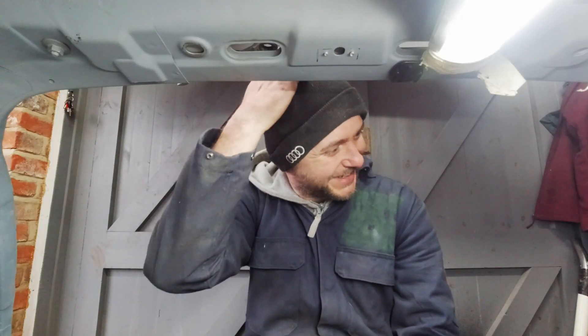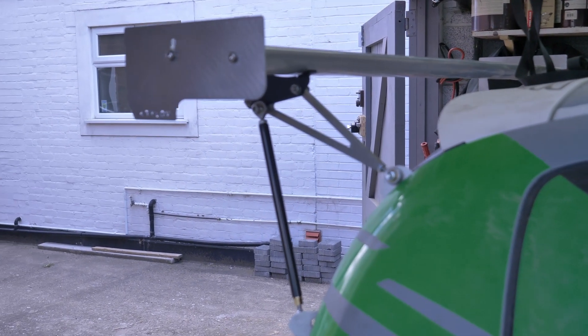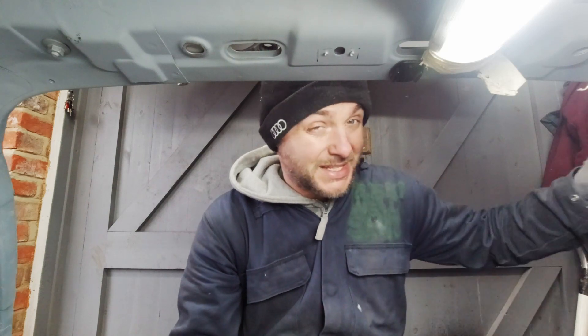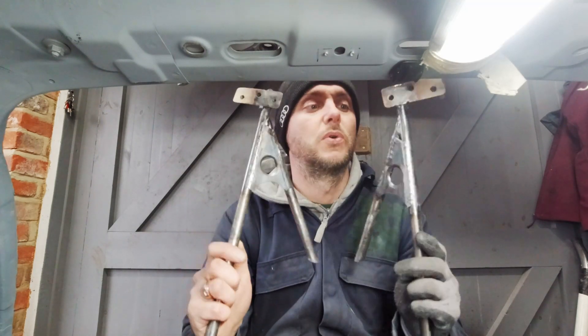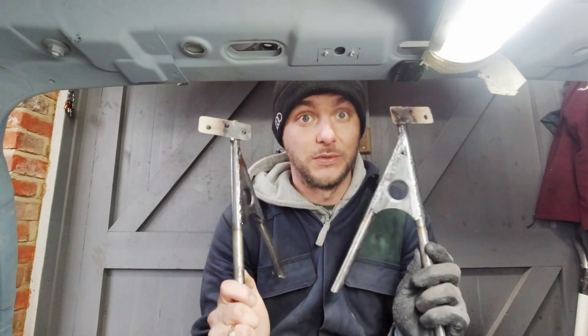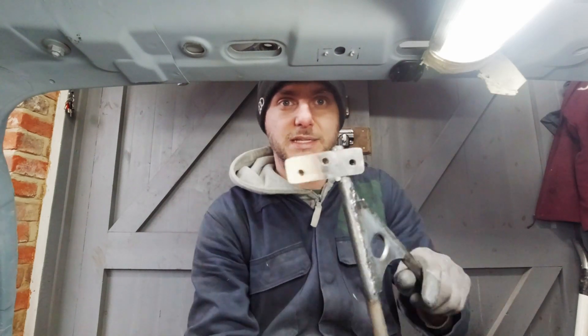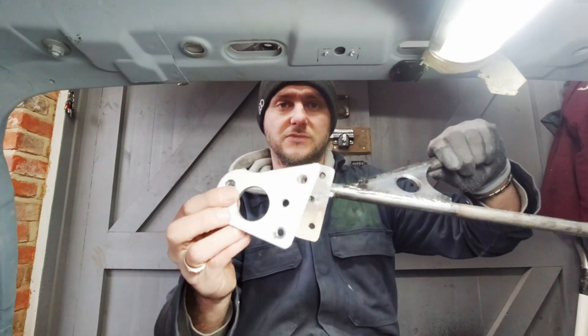About 75% of you are not subscribed to my channel — just hit that subscribe button and the bell icon so you don't miss future content. We've removed quite a bit — it's actually two and a half kilos of dead weight. The main reason: my wing has always been attached to the B/C/D pillar and I wasn't 100% happy with it because it's supposed to be attached to the chassis. By removing all that, we can add something else — supports I've been thinking about for a long time to mount the wing directly to the chassis.